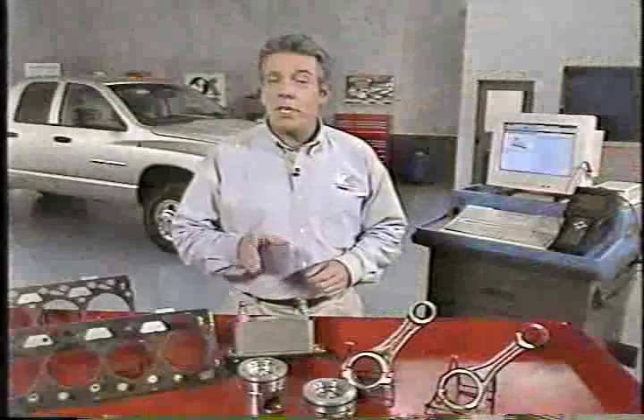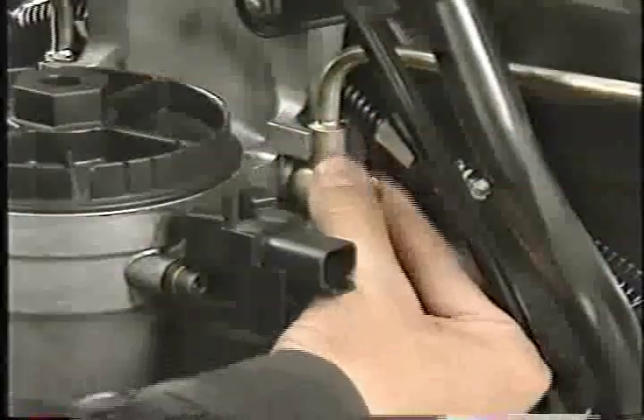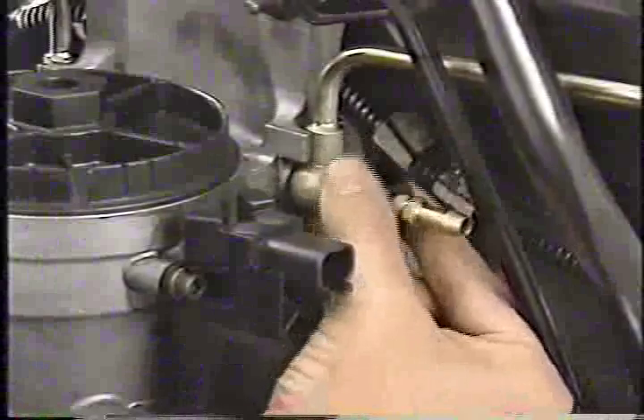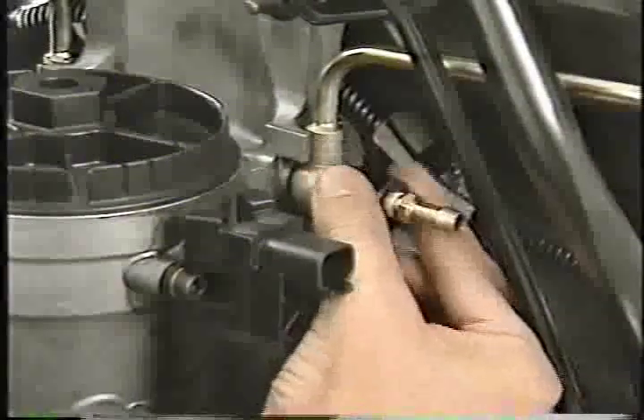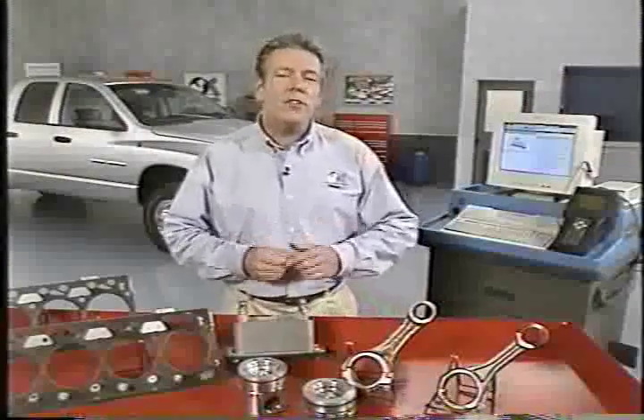Excessive return flow is also used to troubleshoot the injectors and related components for leakage. For this test, once the engine has been warmed up, remove the banjo connector bolt from the rear of the fuel filter housing and install tool number 9012 in its place. Install a hose on the test fitting and route it to the fuel tank or a fuel container. This isolates return flow from the high pressure pump so that the next test connection can measure return fuel from the engine. For that, disconnect the vehicle fuel return line from the engine fuel drain tube and install a hose on the end of the tube.